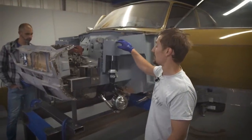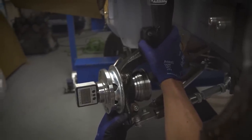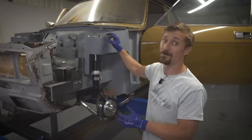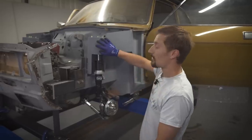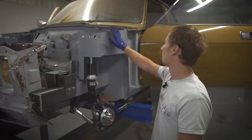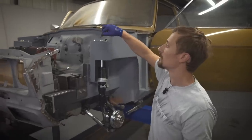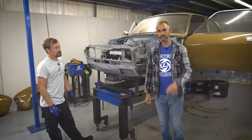When it comes to the strut top side of things, the beauty of having the jig set up was that it would fix the camber angle and caster of where the strut top was. I aimed for roughly five degrees lean-back on the strut top, used the jig to fix the hub, and that gives the exact strut top position — which should hopefully be symmetrical on both sides. Then it's just a case of building steelwork around it. Started with the actual tower assembly, cut some out to relieve weight, shows off the spring, and then building an inner wing section — this is where all the strength comes from, tying it back into the bulkhead. We'll need a strut brace across to the other side, back to roughly the middle of the bulkhead.